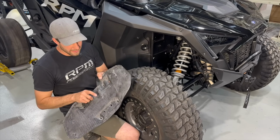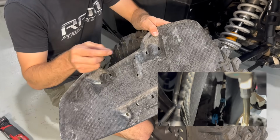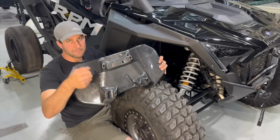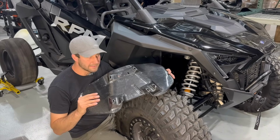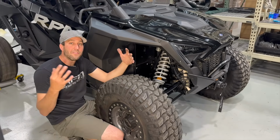Quick rundown. The front differential plugs, this is where they're gonna plug into now. There's a little Christmas tree clips. These holes are for the zip ties. Just gonna loop around it, pull them tight across the frame. It's simple as that. It's a tight fit. We're trying to use as much of the air to keep it off the firewall as we can.